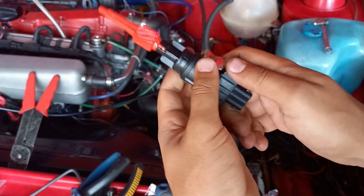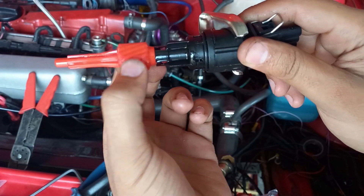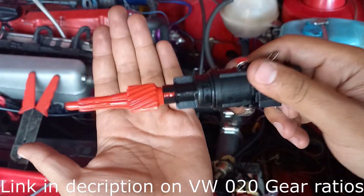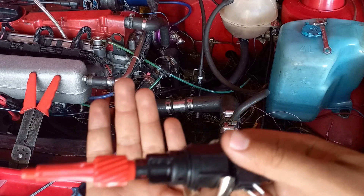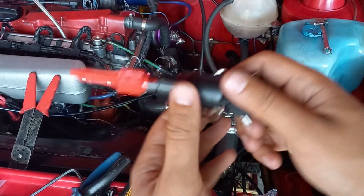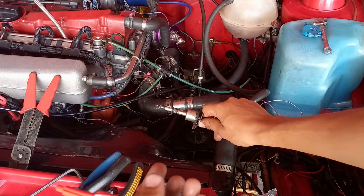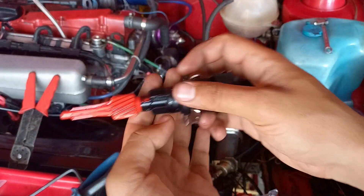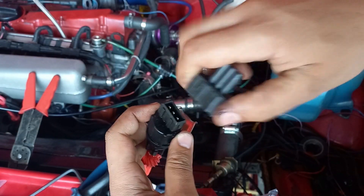Previously I had a white gear on the cable, but I'm now using a red gear which I've already installed and driven the car with. The red gear has fewer teeth — you're supposed to use a red gear with the 3.6, 3.62, and 3.64 final drives. Those use 15-tooth gears, while the 3.9 final drive and newer code transmissions use a white gear. So this was in my car and now I just have to figure out which pin runs to which terminal.